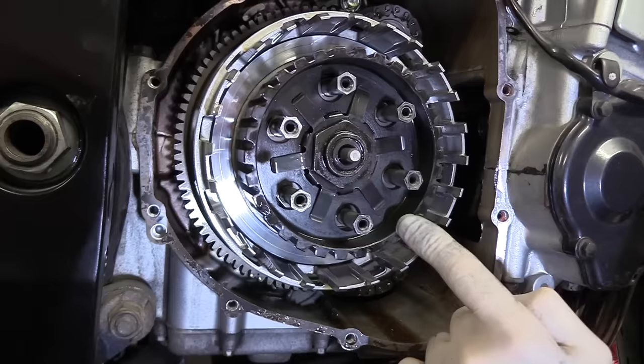And that's probably a perfect example of why the problem was those springs. They're heat fatigued, they're all soggy, the old clutch springs. Definitely need a replacement. Stick a new set of friction plates in there as well. There is, as I said, as you saw, a little bit of bluing on the plates, but nothing drastic. They'll always be like that when you pull them out. It's quite normal, but what you're looking for that would be signs of trouble would be skid marks around them where they've literally been scraping, and there's none of that whatsoever. So they're absolutely fine. I've put them in far worse than that and they work just fine.